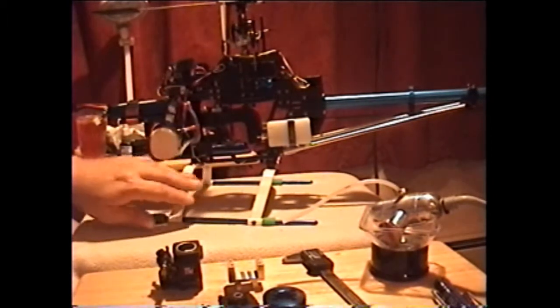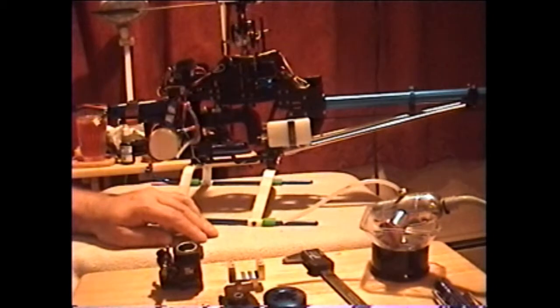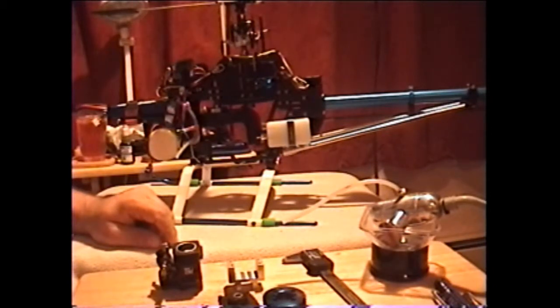As you remember, I've been having trouble starting this Quickie 18 Heli. I pulled the motor apart a few times, cleaned it, and tried to start it. I think I was just not getting enough compression, because it wouldn't run right or smooth, and it was hard starting. I had to order a start shaft and a new clutch because I tried to start it for so long, almost as long as the Align battery and Align cordless charger would last. I started with it charged and ended up killing the battery before it even started to rumble.